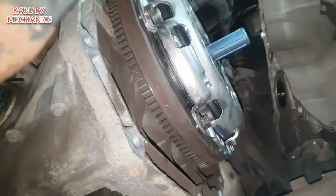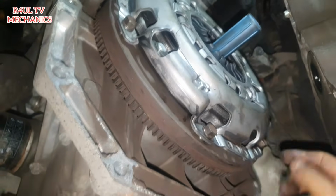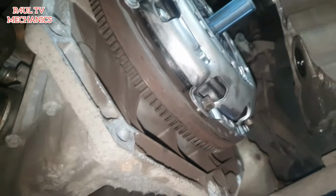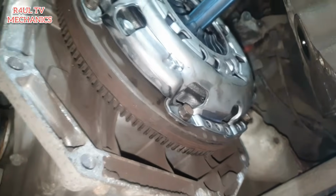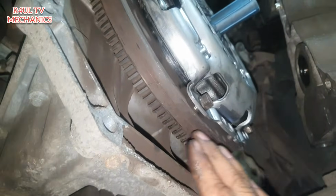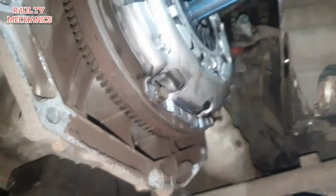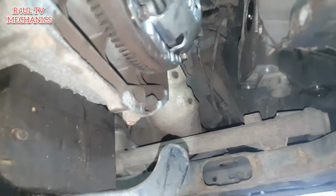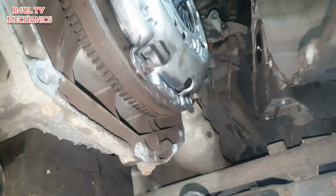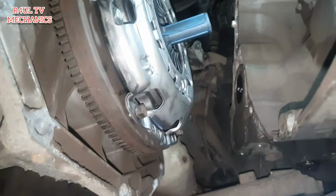That's good. As for the torque settings, if you go onto the technical data, Autodata, it should give you the correct torque settings for these bolts. If you don't want to use the torque settings, which I'll be honest, I don't really use, I just make sure I lock the flywheel up, lock the crank pulley up and then tighten it up, just proper tight. Make sure you do lock the flywheel or the crank pulley up, because when we tighten it up, the engine's going to turn counterclockwise, and we don't want the timing chain to jump or anything like that. So make sure we do lock that up, and yeah, let's go ahead and do it. Let's go.